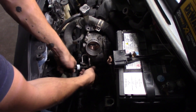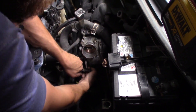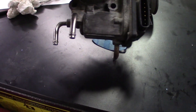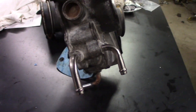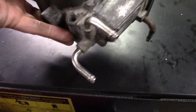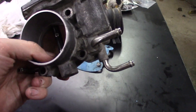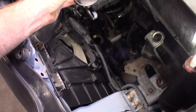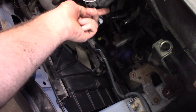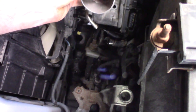I just basically pulled the whole tube down a little and kind of twisted it out of the way for test fitting. Right into another problem here. I just took the coolant tube and bent it down so it's on a 90. Might be a little loose in the throttle body itself but they're pressed in anyway so it should be okay. We're most likely just going to bypass the coolant lines on this to keep the throttle body a little cooler and hopefully get a little more performance out of it. We still have a little bit of a clearance issue here — I'll just bend this one this way and that should give us some clearance.